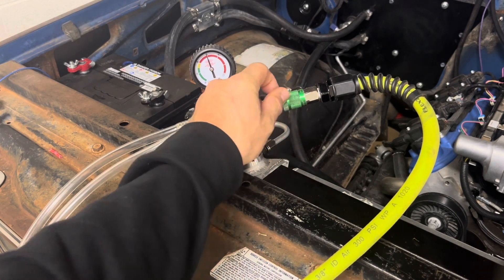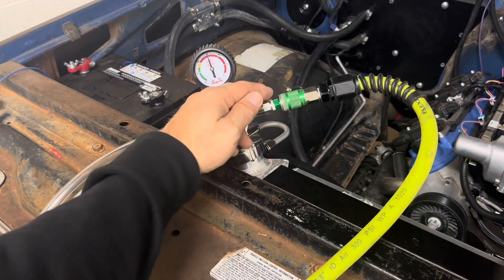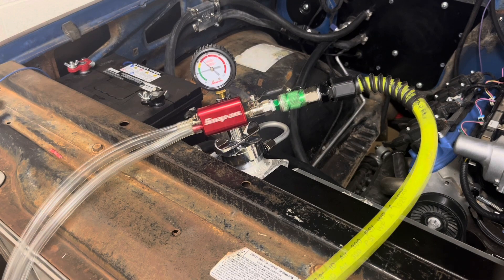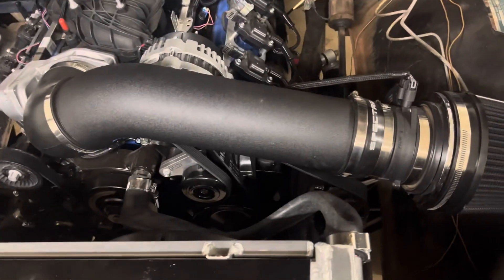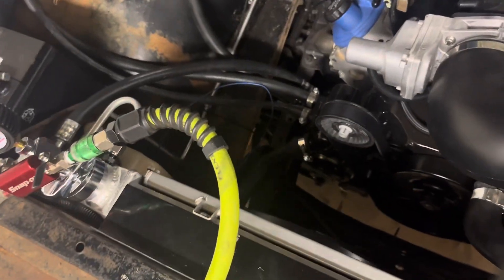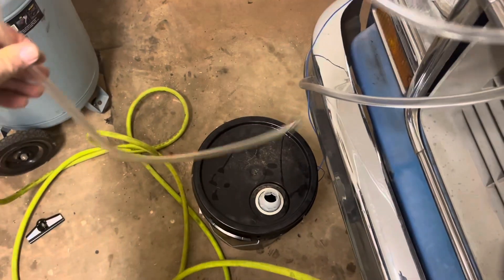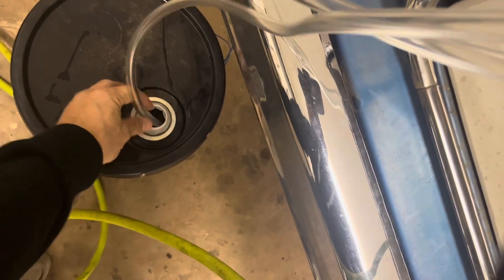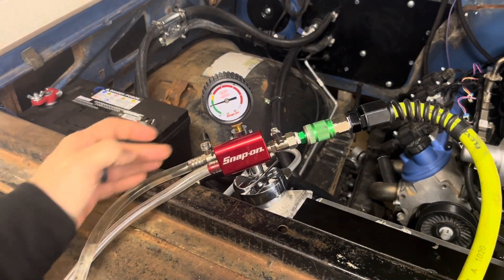As you can see it's currently pulling a vacuum — we're at 15. Quick check right now: you just close it and you would know rather quickly whether you had a leak or not. Okay guys, we've got a good vacuum on it now, it's holding. As you can see the upper radiator hose is sucked flat and the lower radiator hose is sucked flat. Now we will just get our fill hose, which has a filter on the bottom so if you have some dirty coolant it'll keep from sucking up any nasty stuff. We'll just put it in our bucket.